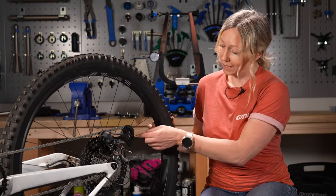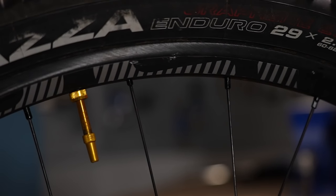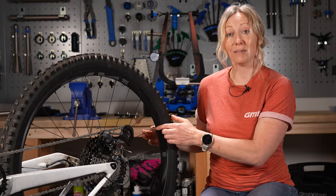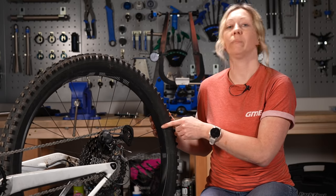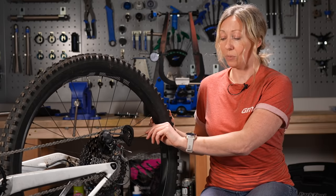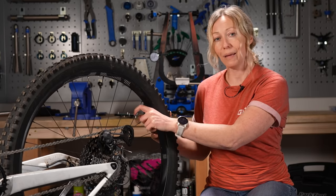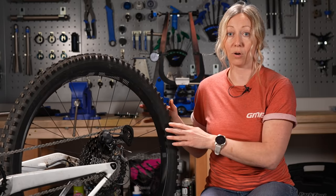What I've got here is a few loose spokes. Luckily, I've still got all the nipples intact even though they are severely loose, which means I can tighten them back up and even straighten them a bit. If you've lost any of the nipples into the rim — maybe they're rattling around — or if you've broken a spoke completely, you might want to take that spoke out for safety's sake, or at least wrap it around another spoke or tape it there, just so it doesn't rub on your frame or get caught in your drivetrain.